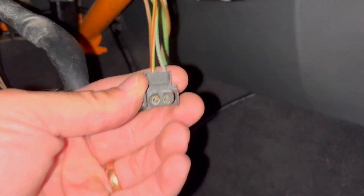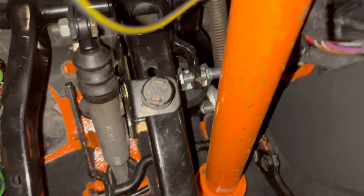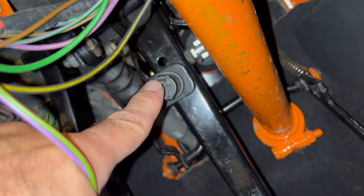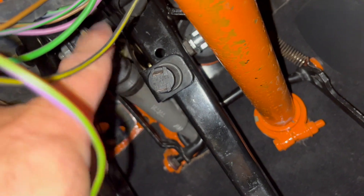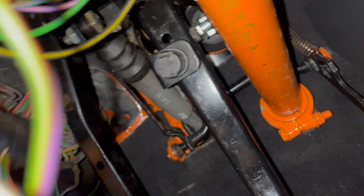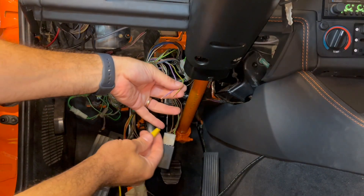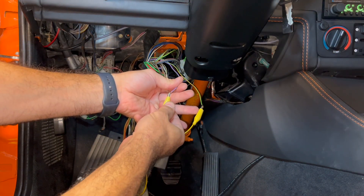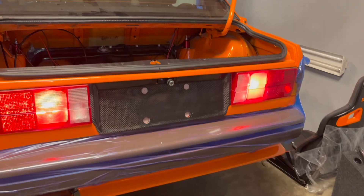Next to the brake lights - here is the connector for the brake lights and here is the switch for the brake lights, and as you can see the switch and the connector are not compatible. We need to cut these wires, put spade connectors on them, and put them on there. It's really just the difference between early and late model - it's just a different switch. We could have gotten a late model switch and just plugged it in, but the spade terminals will do the job fine. What I'd like to do first is put a jumper wire across them, pretending I'm pressing the brake pedal. Let's see if the brakes are on - and they are! What about that third brake light? Just put a bulb in.